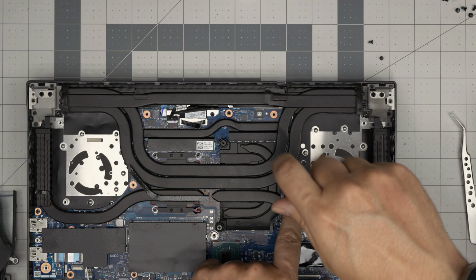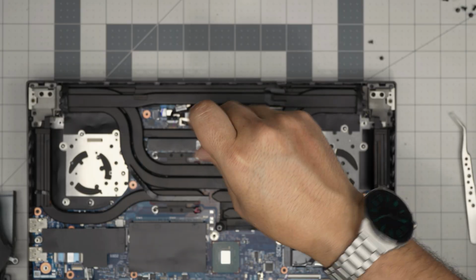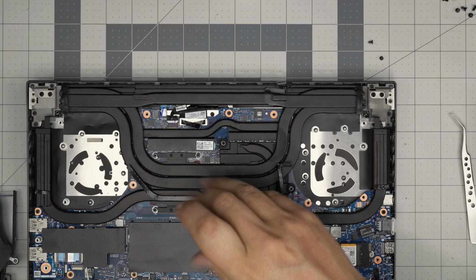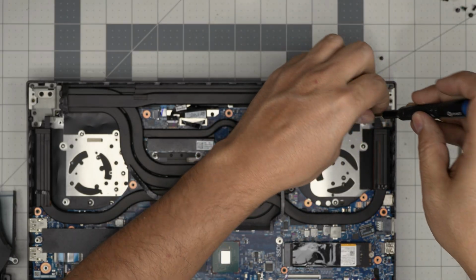Next, you want to tighten up the screw all the way to this side of the GPU. It doesn't matter whichever you want to start next. It's a triangle, so there's no cross screwing here. Put the one tiny screw on each corner on the back.